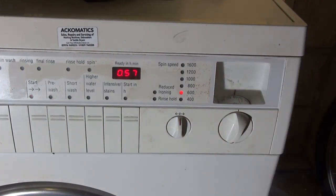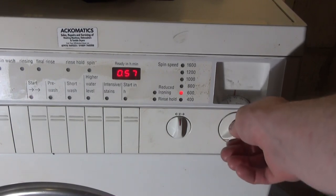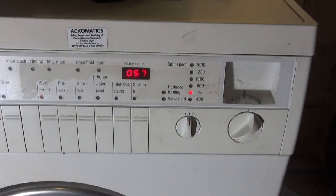Then we've got Delicates at 40, 30, 15, yep, no cold here, just 15. It's likely that you will still actually heat it to 15 as well. Even if it's over, if it's like 6 degree water, you'll heat it to 15 regardless. Because Miele does the same at this time area. There's cold wash functions on the Miele, and they would always heat to about 18 degrees because detergents don't start working until they're at that temperature.